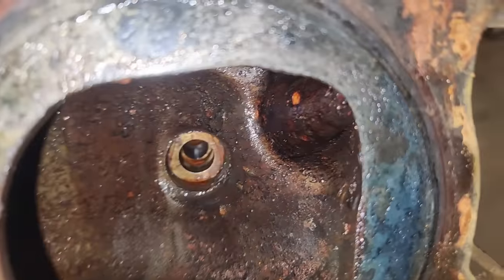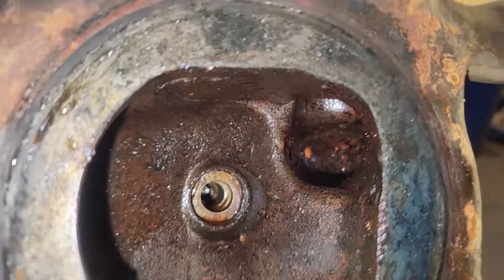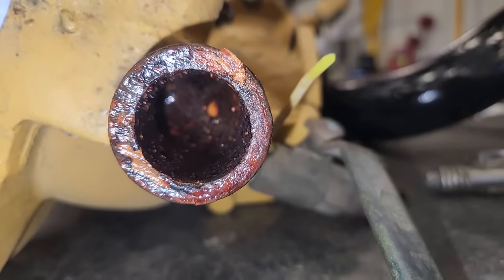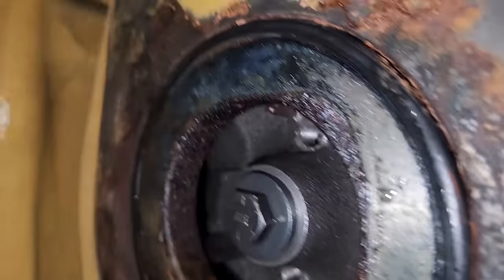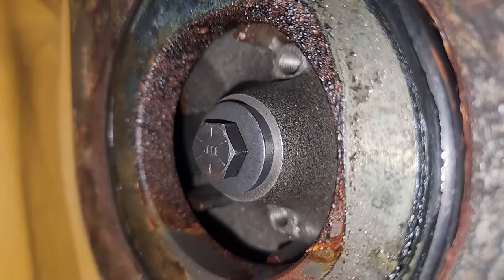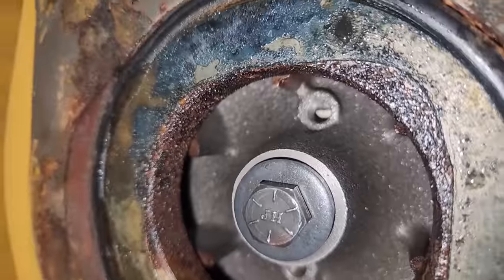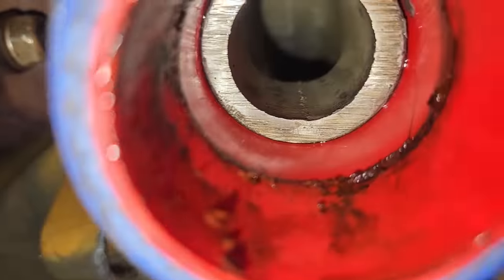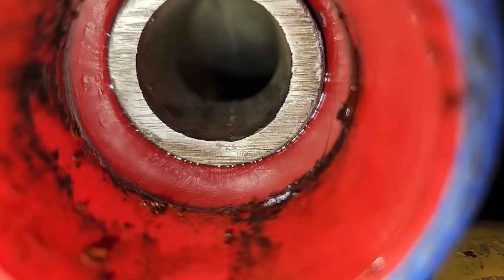Let's get back to work. This is with the back part of the water pump section off. You can see it's got quite a bit of rust — that's up into the thermostat housing there. There should not be rust there, especially with new coolant — very unusual. There's rust on the back here too, also strange. The water pump, from what I can tell, looks pretty good. This is the view into the thermostat housing. At this point I had no idea what the heck was going on.